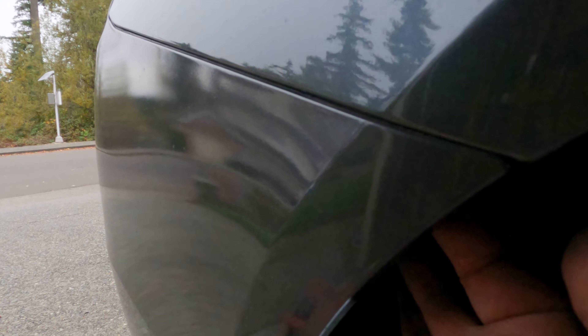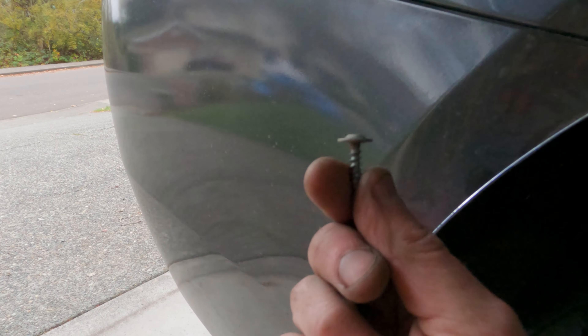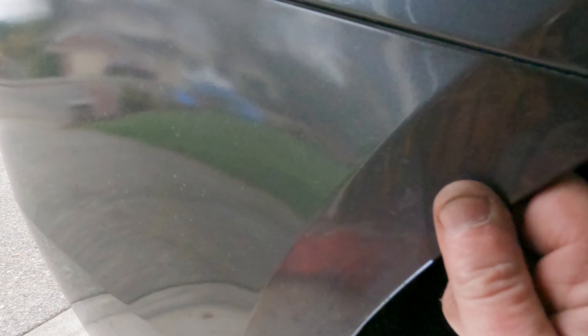You can always take your wheel off to do this work, but I don't think you really need to. The reason why we took those three eight millimeters off is you reach in and pull this splash guard out and away. Where your body panel meets right here on the inside, there's a T20 that's driven straight up. This has a loop on the inside of it, and this bolt goes through the loop to secure this corner. Once this is off, the whole piece will peel off. So just pull this cover back with your hand, peel it back, find that T20, and it will peel right off.